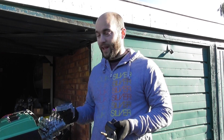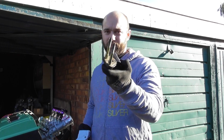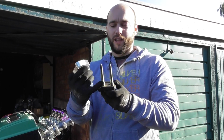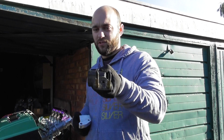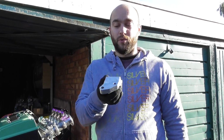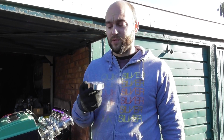With Honda engine mounts for the B18 engine and other B series engines, there's different left brackets that you can use. This is the standard one for the B18C4, and as you can see, it's the 3-bolt style affair. It's got 2 sticking up and another one that you screw down from the top. Now that would be fine if it's going back into an MB6 or something like this, but if you want to put this into the Civic EF, you need this part here. There is actually a Honda part that you could try and find as well, but that's actually long since discontinued, and Honda don't have it even themselves in stock.